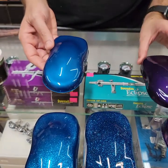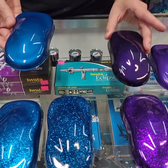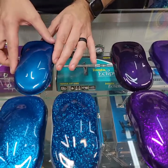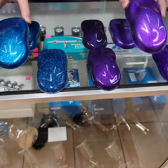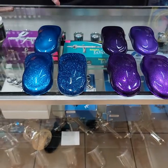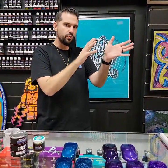One of the things you're going to notice right away — these bases aren't crazy, they're not full of metallics, not full of pearls. They're designed like that so when you look at the flake sprayed over it, the flake is not fighting with the base coat. The same color you have on the face is the same on the flop. The last thing you want is to shoot your flake, it looks great, and then when you move around at an angle you can completely see the flake standing out with visible specs.